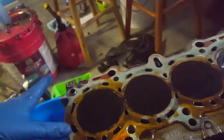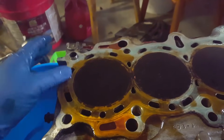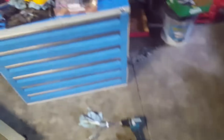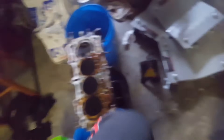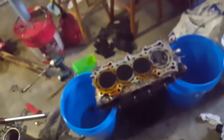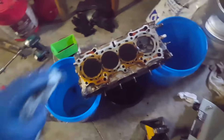This is my first time trying it, so I'm also going to be learning from this experience as well — hopefully we can both get some cool tricks off of this experiment. I've got it full — basically a puddle of it. As I did in my last video, I left the piston soaking for about an hour and a half, almost two hours. The Chem Dip instructions specify to keep aluminum soaked for under four hours. I'm not exactly sure why — I'm assuming it has to do with a coating being taken off the aluminum or something similar.